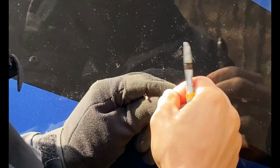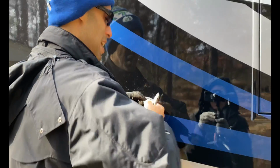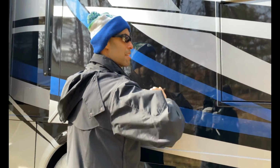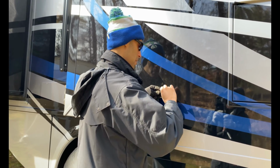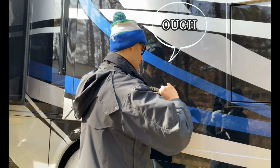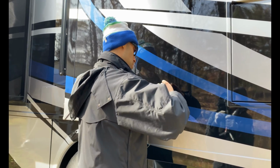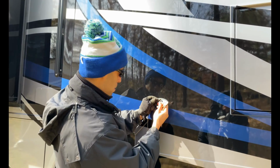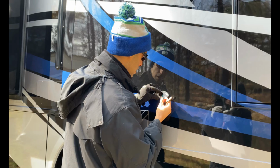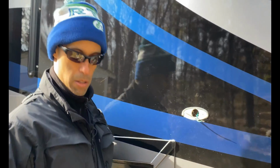There you go, so it's done, okay? So now we have our 2 stripped wires. The white is gonna be the ground, because we tested it, right? And the green is gonna be the power. When I say power, I mean that's the one that, I just stuck myself with some copper. That's the one that the power is coming from, okay? You wanna twist these down a bit, get the copper nice and tight, all right? Pull it out, make sure everything's good here. I don't want it to run back into the wall because that'll really suck.